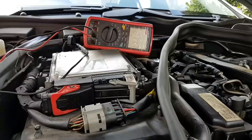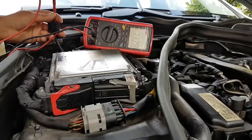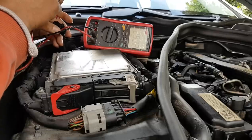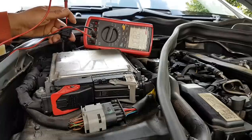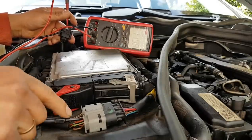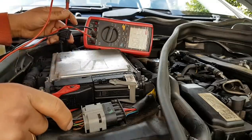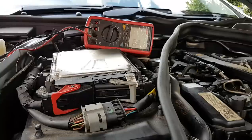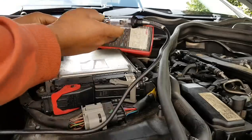Pin number three should be my 5 volts going to ground. Testing now - we have 5.03 volts, which is good. And checking the ground - I'm back-probing this wire and we have 11.99 volts reference, confirming a good ground. But to make sure I have a solid ground I'll do something else.